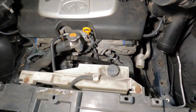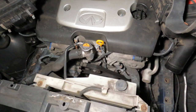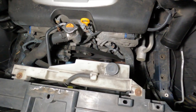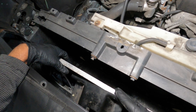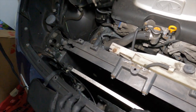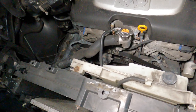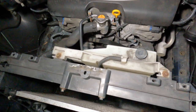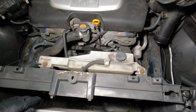To start out, I've cleaned down where the radiator goes — there was quite a bit of coolant there. Now I'm just double-checking to make sure my clearance is correct for the radiator to fit and clear the condenser. I'm going to zip-tie this bracket to one of these clips or to one of the holes where the clips go, so it'll keep this held back. That way I can focus on holding the condenser back without having to hold that bracket back too.